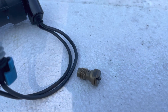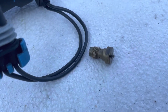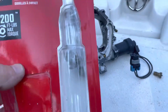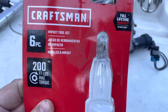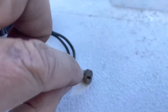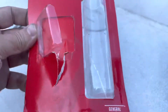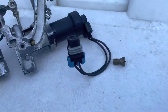Getting this power valve out was kind of a pain. I could not get it out with a regular screwdriver. I tried a flat blade — it wasn't quite wide enough. I tried another flat blade — also not wide enough. So I finally had to go to Lowe's and buy an impact tool set. The way this impact driver works is you put a wide bit that fits inside that slot, tap on it with a hammer, and it not only twists but also drives down to help keep the bit in the slot.